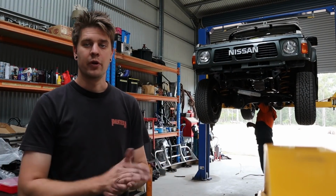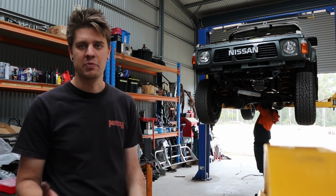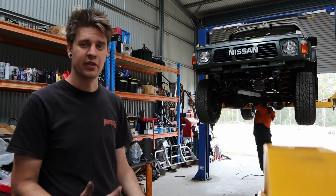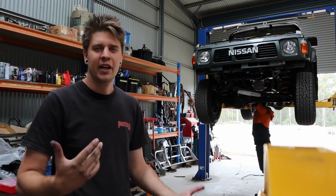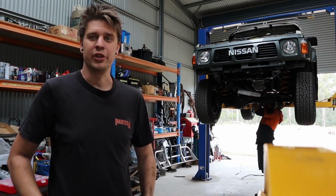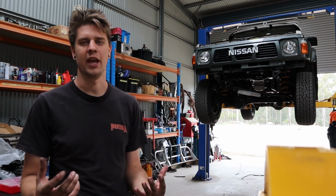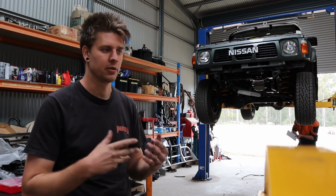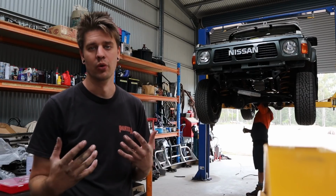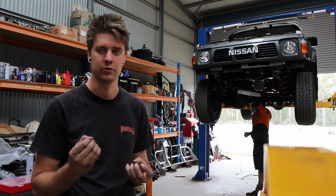So anyway, guys, super frustrating at how well everything is working with this rig, how good it's making power. Everything's freaking ace. Obviously, we still have to give that box a really good test on a road drive, but apart from that, everything's awesome except for this freaking issue, which we still can't pinpoint exactly what the cause is. So at the very least, now we know that we have a way that we can get around it if we need to. We could bridge this injector driver with another driver, run two injectors off the same driver, and it will fix the issue. But we'd rather obviously try and find out what the actual source of the problem is.